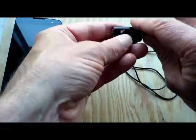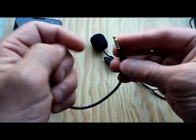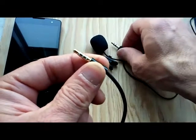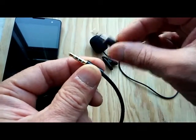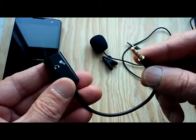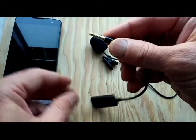This TRS connection is not going to work as-is in your phone's 3.5 millimeter jack, so you're going to have to get a tip ring ring sleeve adapter — notice that's three lines there as opposed to the two lines on the tip ring sleeve. You're going to need this TRRS adapter to pick up the microphone.